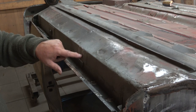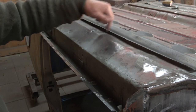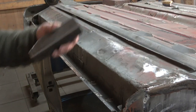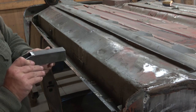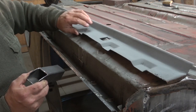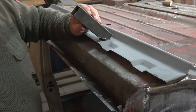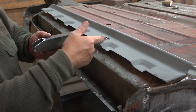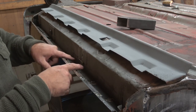What I'm going to do is cut this inner sill out, which is right in line with the box section inside the car. Once I've cut this out, I'll make a box section like this — you can see I've already tapered it — and that slots inside there, which will come in line with the hole that's already in there. This basically slots in line and then you can just weld it in. I'll show you on the other side how I've done it — I've put a box section underneath it.